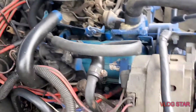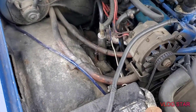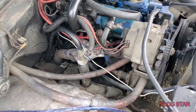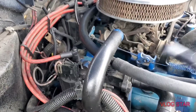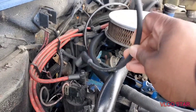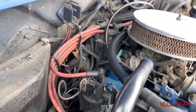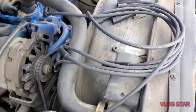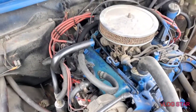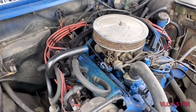The way I do it is start off with the small wire. You can't mess this up — some people do mess it up, but you really can't. You got the smallest wire that goes from the coil all the way to the distributor cap. Start off with that one, then just look at the length of them and do them as you go.